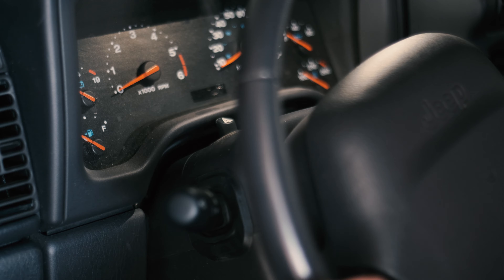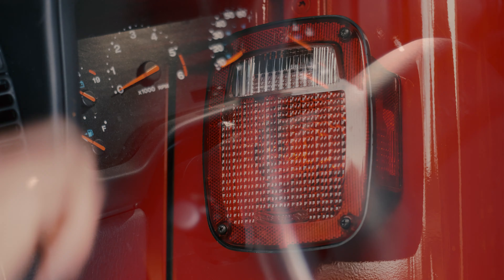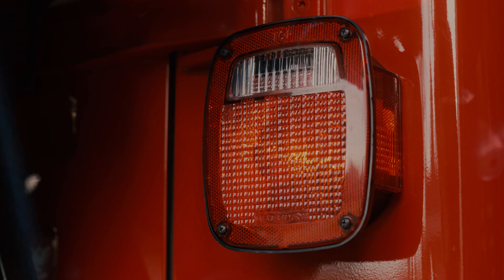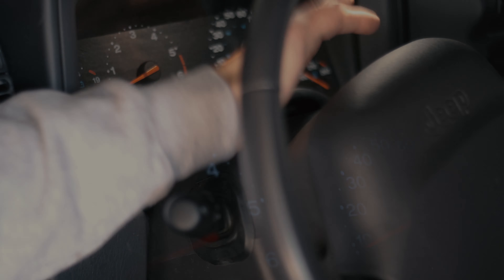Once that's all buttoned up, you can put your steering wheel back to wherever you had it and you're good to go. So now you're not going to have any more hyperflashing when you switch over to LEDs. I'll put a link in the description to the flasher. There are certain years that use different style flashers, so look up your year to figure out which one you need — I'll put a link in the description to help with that.